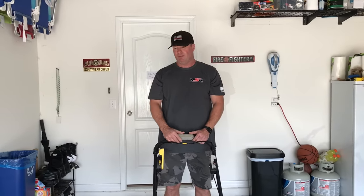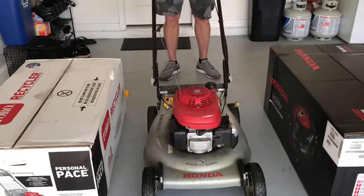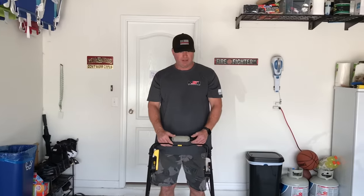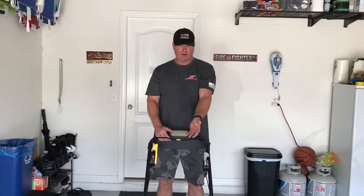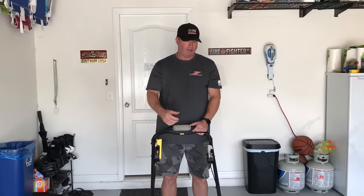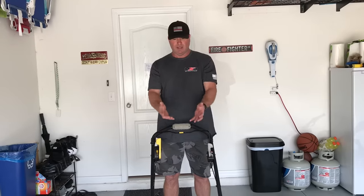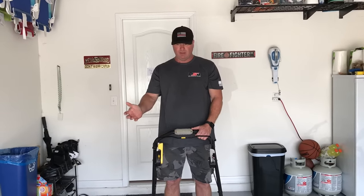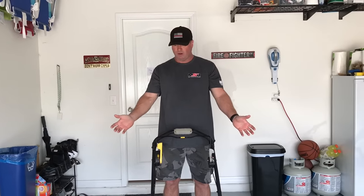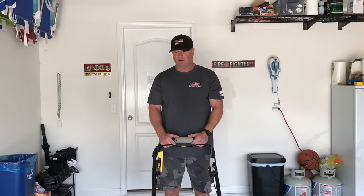I have to mow my yard twice, but it shouldn't be that way. I would think 15-year newer technology should enable these mowers to mow your yard on the highest setting the first time. I know the Toro is a single blade. This is a multi-blade, much like my 15-year-old mower, so it has two blades. I've sharpened the blade, bought new blades, changed the bend on the blade by heating it up to create more vacuum, and even sped the governor. I'm not an electric guy — right now I'm a gasoline combustible engine kind of guy.